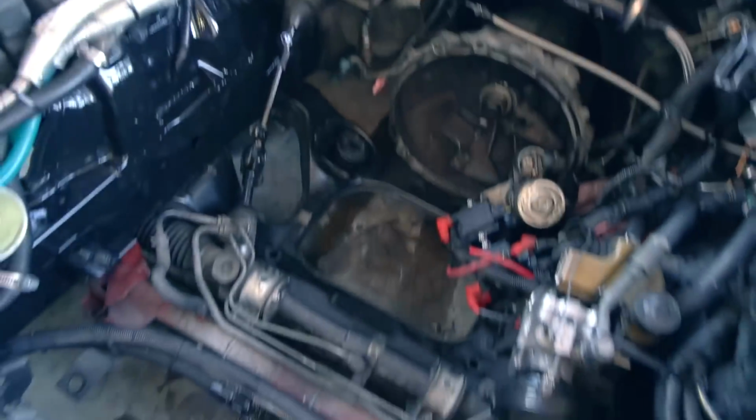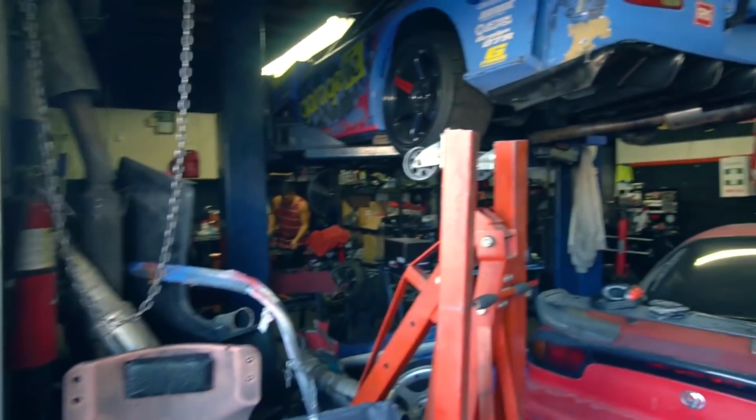What? What happened? Oh no, that's not good. Dre, what did you do? So he was converting from the stock sequential twin turbo setup to a single turbo setup, and they went a little ham when they were setting that up and driving it, doing a lot of street pulls, and the engine blew. But it actually might end up being a good thing, because now he's oversized studding his entire block, getting the Garage Life oversized stud kit, which will make it a lot more reliable, and he can make more power with less risk on the new engine.